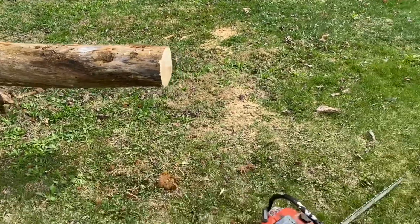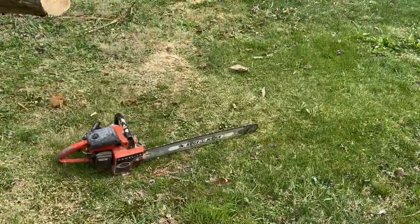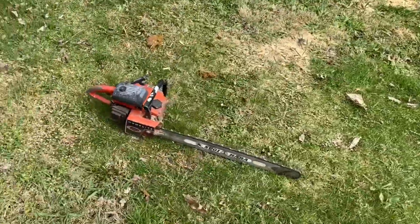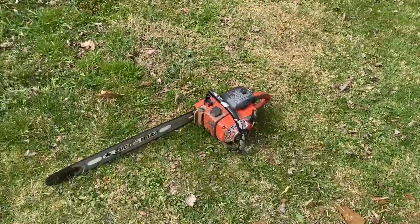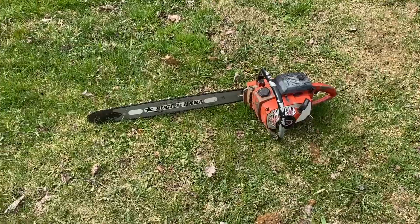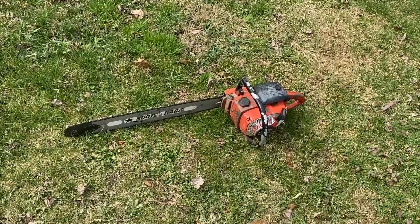Now if you've seen me do this bore cut on this saw, that's because this is the one I plan on dropping that oak with. And you don't want your chain very aggressive for a bore cut. This tree is going to need a bore cut. I showed you a bunch of methods about sharpening your chain, keeping them cutting really quick and fast. Well, if you're talking about bore cutting, you want to ignore some of that. So keep that in mind.